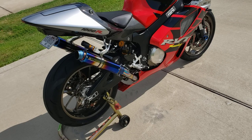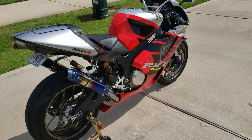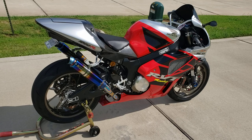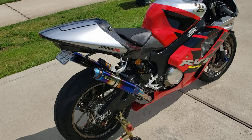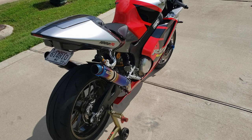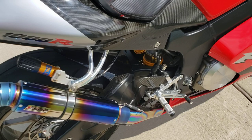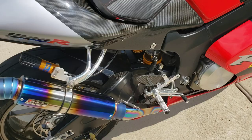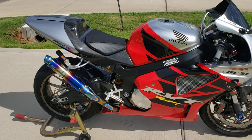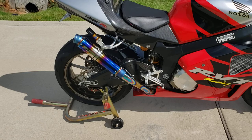They're in rainbow titanium — a 60mm inlet and 60mm outlet. They also offer a 45mm or 54mm version, which actually sounds not quite as deep and rumbly, but if you ask around, that's the one to get for performance — it runs a little bit better. These big giant open canisters sound great, but they're kind of a challenge to tune and don't run as well as the smaller diameter canister. So I went with sound over maybe one or two horsepower. Great system. It's also got the Lady Bird hangers — hand-bent, TIG welded aluminum, polished. I love the swept-back nature of them. To me, they're better than the Sato, which are out there.